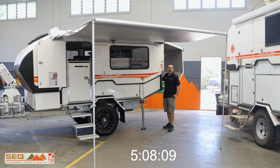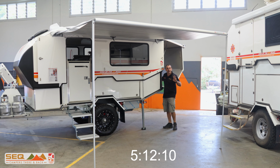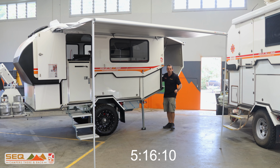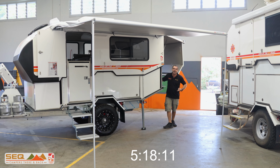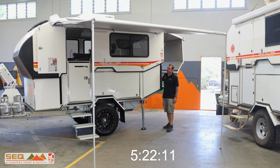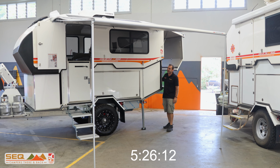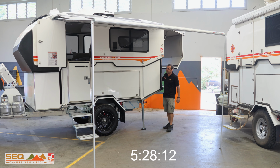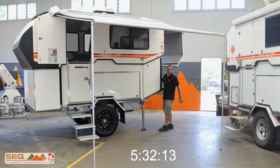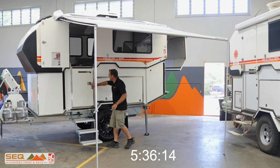We're running a 30th anniversary here. It has the actuator inside. So 3 ways to set this up again. Switch on the back, remote control, but there's also a manual wind here on the actuator of the 30th anniversary Caravan. When I go all the way to the top, I'm going from 2.3 meters all the way up to 3.3 meters. And right now I'm just looking for my stop line when it gets to the top.